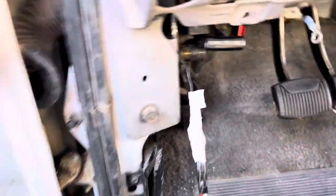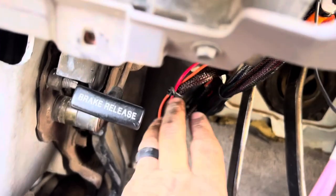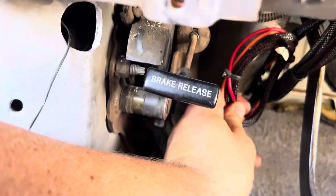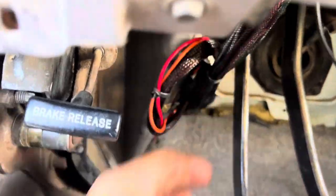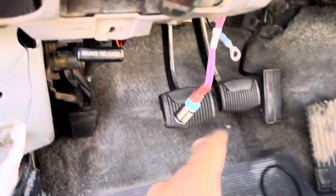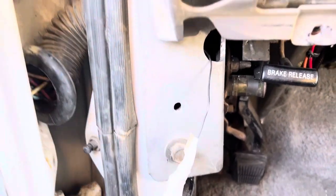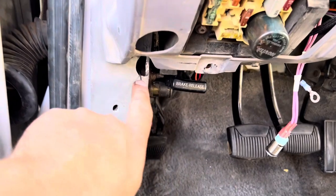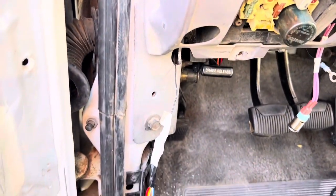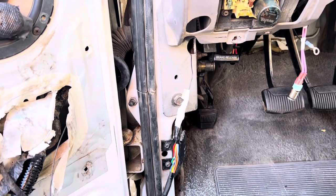Use a wire fish through the grommets. Most of the time there isn't a big hole there or those metal shavings. I like all my stuff nice and tucked up — I didn't want anything running down. This is for my auxiliary wires for some interior stuff that's going to get used eventually, but even though it's loomed and up out of the way, I still don't really care for it with this panel on. I'm definitely not going to run anything down underneath and try to fish it up to that grommet. So I got a hole saw, made sure there were no wires behind it, and just drilled it through. That's much easier. Some people don't want to cut up their truck, but this is like a 30-year-old truck — who cares?